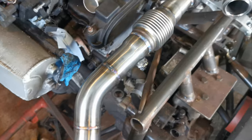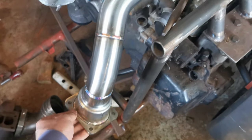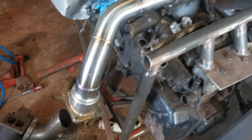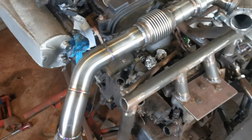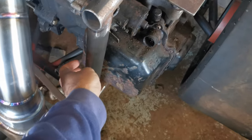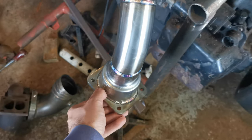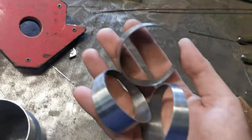Putting this flex in here was a really good idea — it's given me a lot of wiggle room, can you see? Even with solid engine mounts, when you take the engine out and put it back in, everything shifts — everything's just in a different place. The turbo is going to be mounted to the chassis here, and it'll just give us a little bit more play to get this on.